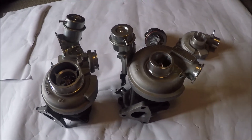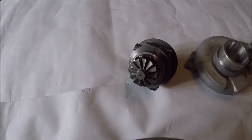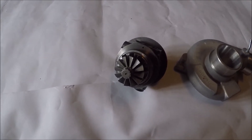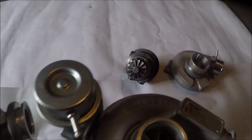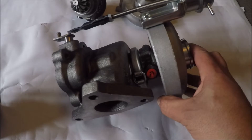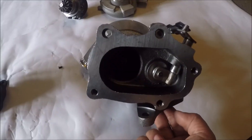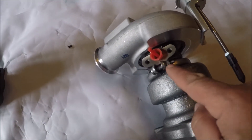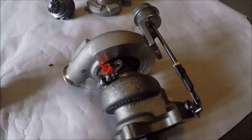The HE211W has got the exact same size turbine wheel as a TD04L like you'd find in countless Subarus — Legacies, Imprezas, Foresters and so on, as well as millions of other cars. Anything with a TD04L turbo, you can basically take the housing off that and fit it straight to a HE211 turbo and make it a direct fit for your application. All Imprezas with a TD04L turbo — this is just the housing which I've bolted straight on with literally one 10mm clamp — and you can fit the turbo straight to your car.